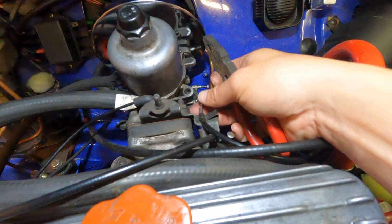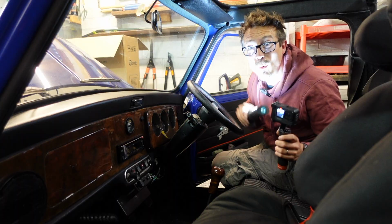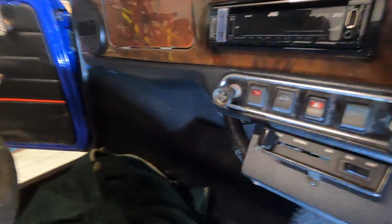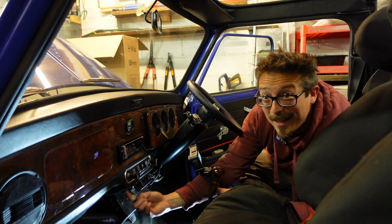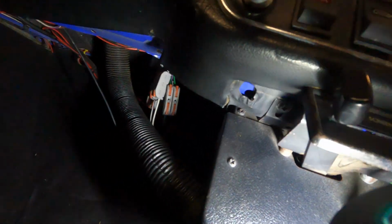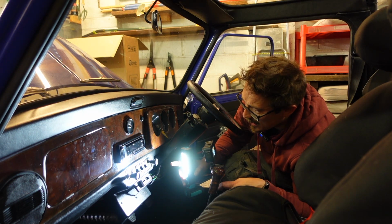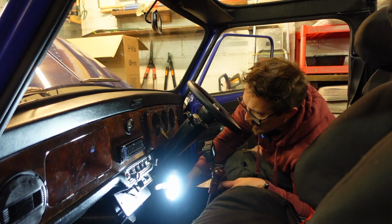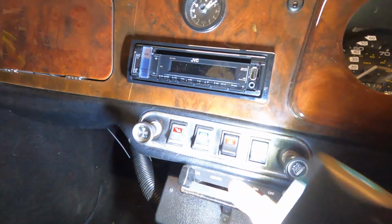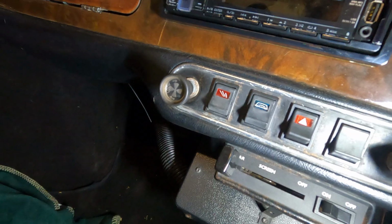Next thing, we're just going to get this clip off so that we can have this cable ready to pull through. So I think this just pops off. Okay. So the next thing to do is to try and get this heater out the way, because the idea is you want to get round the back of this here where the choke is living. Now I think there are two screws you can just see right at the back there, and one over here. I think it's those two that hold the heater unit to the sort of center console, if you like. So once those two are out and that's dropped down out of the way, I think we've then got better access to this choke. That's the plan anyway. And then we'll see about unlocking it from the back of this control panel and go from there.